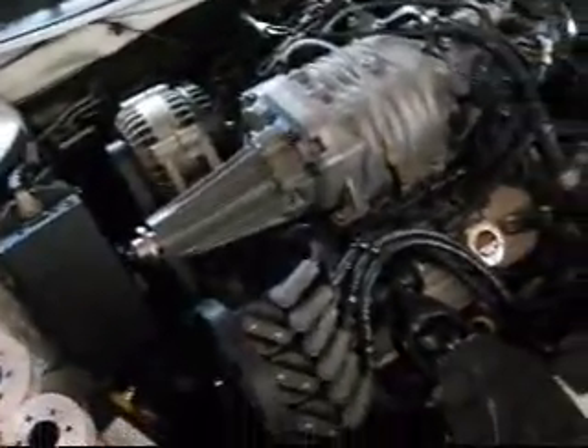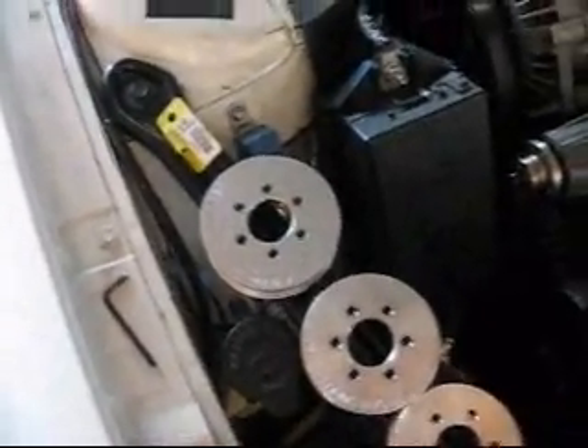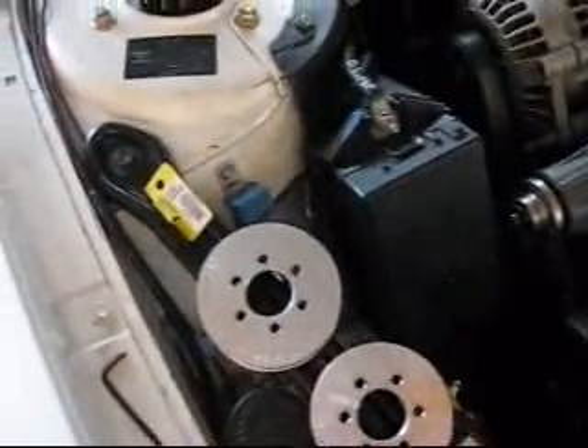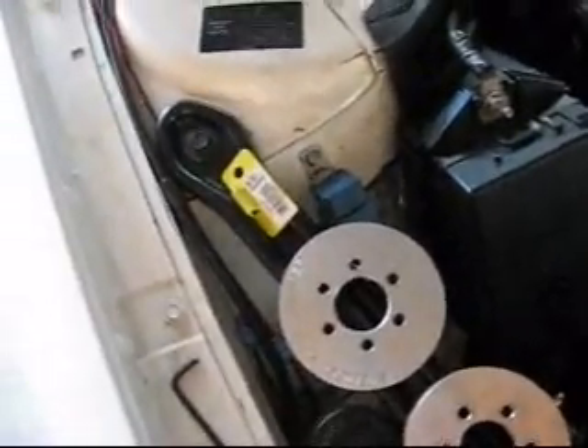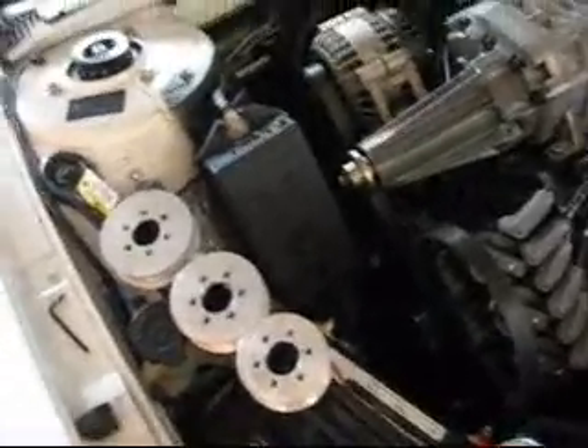Like I said in my older video, the most important mod is a scanner. You don't want to drop pulley sizes down blindly or you're going to blow your motor. But if you have a scanner and you drop down pulley sizes, you're going to like it — it adds a ton of horsepower. Just a 3.5 alone adds 20 horsepower and like 35 foot pounds of torque. So with a 3.5 inch pulley and some supporting mods, you've got a car with more than 300 foot pounds of torque. It's a little ridiculous because of the torque steer, but it's still a lot of fun to drive.